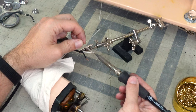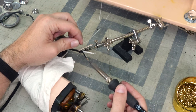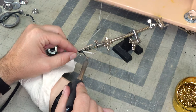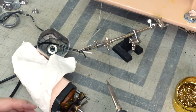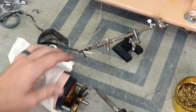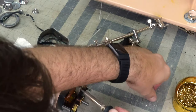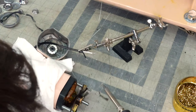So the first thing you want to do here is called tinning. So you're putting some solder on these wires so that they will mate with the other ones inside. So those leads are tinned, and then now I have these old leads, so I'm going to turn up my temperature a little bit on my soldering iron, and we're going to pull these old leads off. Sometimes in order to get it started melting, you got to, oh, nope, we got it. Okay. Yep, that's hot.